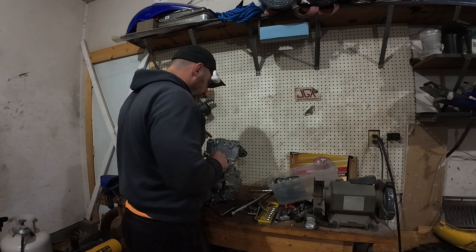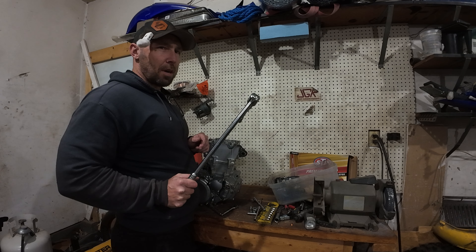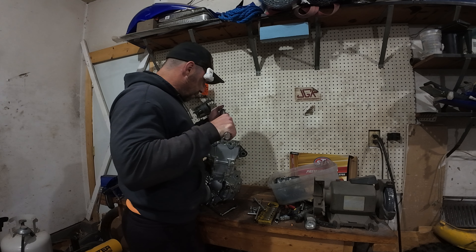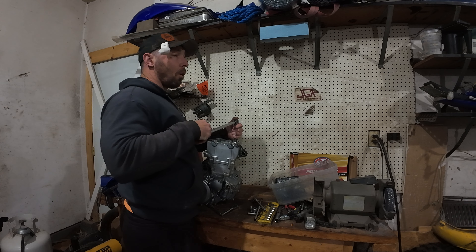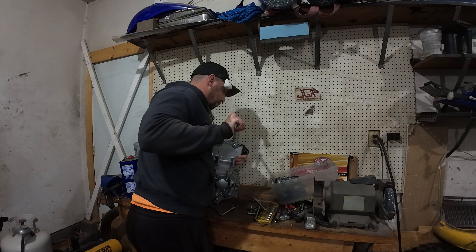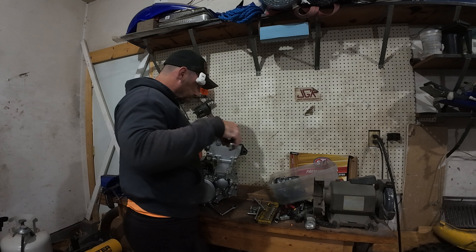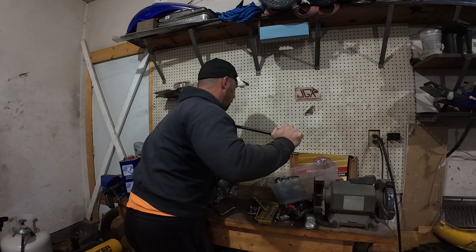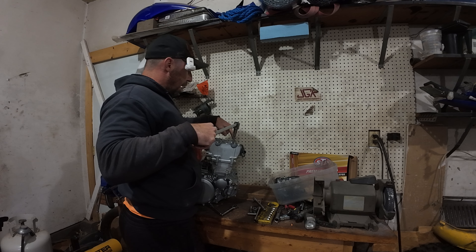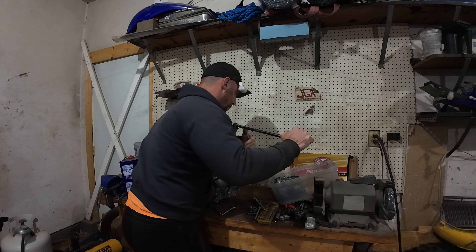You can see these are specific bolts because they have a smooth collar — a certain area that is non-threaded where it goes down into the head. The smooth area is where it goes down into the head. I'm going to itemize those in baggies so I don't misplace them. We've got four head bolts here and I'm going to do that in a crisscross manner. These are usually torqued to about 33 foot-pounds in stock configuration, so it's going to take a little bit more than that to get them loose.